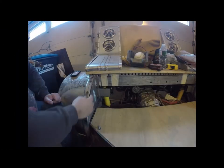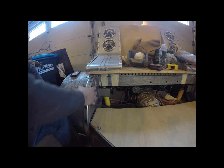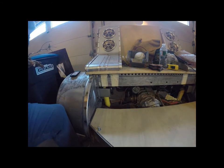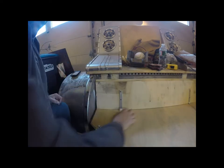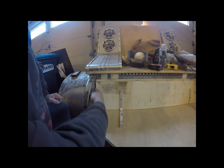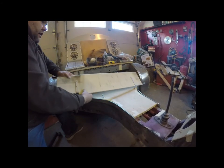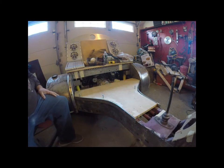As you can see right here, this section used to be open. So I cut out some metal — just did a paper template and cut it out — so it gives a nice side to it. When this piece goes back in, we cut that in. Once this piece is in position where it belongs, you can see we want to work our gaps here. It's wider on the bottom, so I'm going to recut it a little wider on the bottom. We're going to pull this off because I want to make it a bit longer.